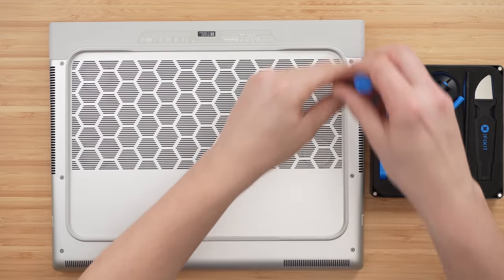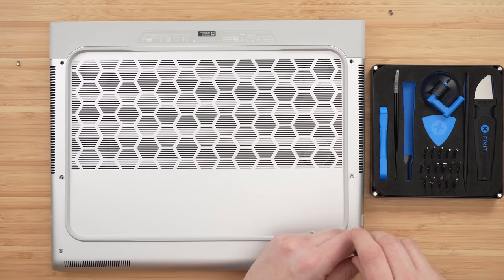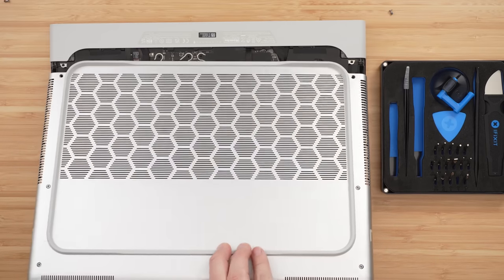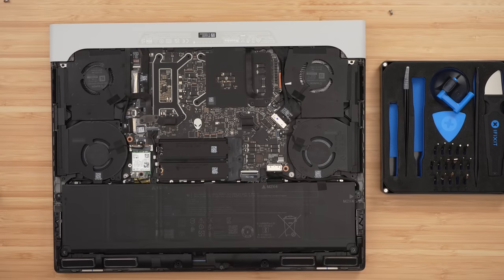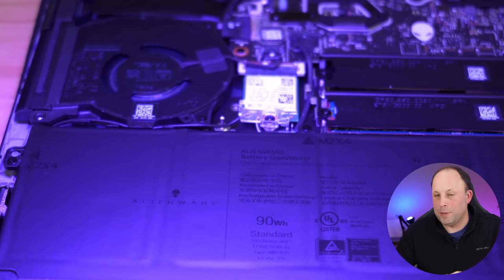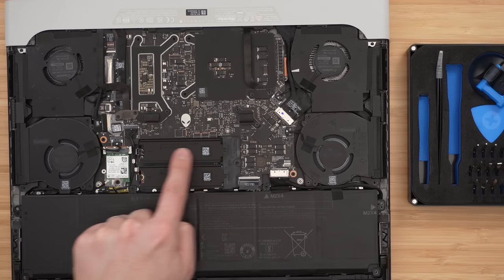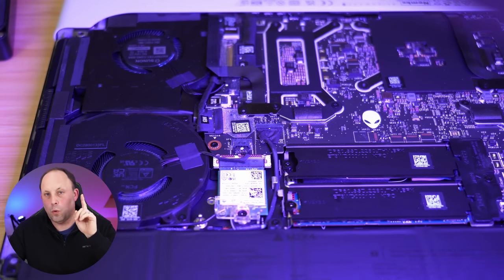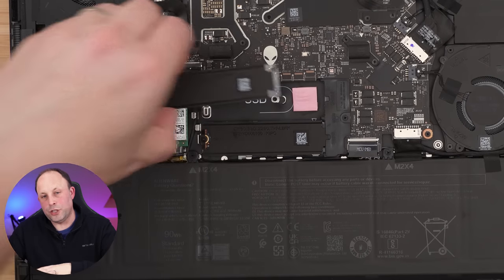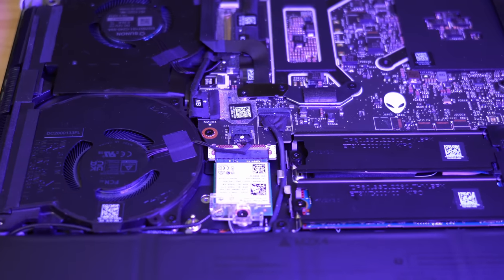Getting into this laptop is very easy — there are only six screws to undo. The two screws closest to the front actually pry the base plate away from the laptop. Be careful, there are some strong clips along the very front, so use a pry tool, then lift the base off. Once inside, you can see straight away we've got a 90-watt-hour battery. We've also got two Gen 4 M.2 slots, and both have heatsinks on them, which is great — we've only got one SSD populated, but there's a heatsink ready for a second SSD. The Wi-Fi 6E card is socketed, so that can be changed in the future.